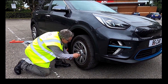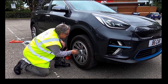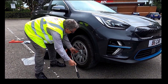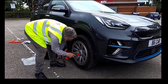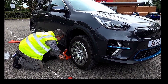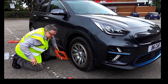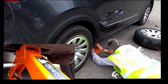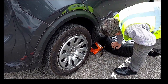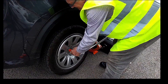Put the wheel back on, put the nuts on finger tight, then tighten the nuts up fairly tightly — sort of opposite each other so the wheel is pulled square. Remove the spare wheel and lower the jack. I'm actually using a screwdriver now to lower it because the jack was very hard to operate with that lousy handle, using the screwdriver as a straight bar to turn it much quicker and easier. There is an adapted nut for about a tenner that you can get to make it even easier.